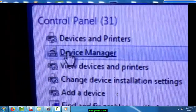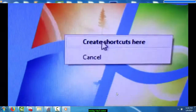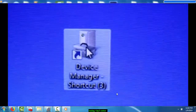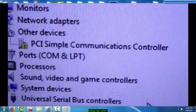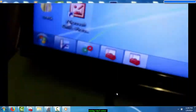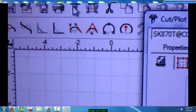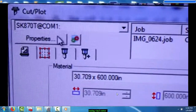I click, hold my mouse, drag it in there and create a shortcut — or just drag it out of there so you can have it open. That's very important. Let me open it. See how it says right here 'PCI Simple Communications Controller,' and on the bottom it shows the port settings — COM1. And when you open your program which is Flexi and try to send something to the cutter, see how it says COM1 — that's very important.